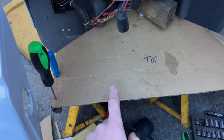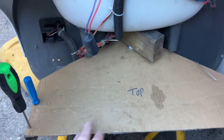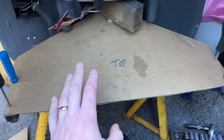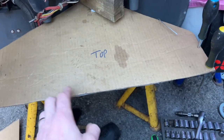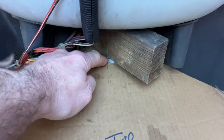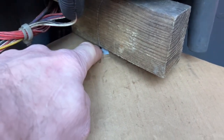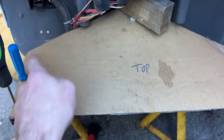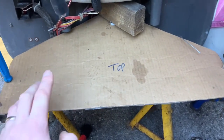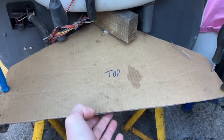Here we go — templates. What I did was remove the axle, lights, and electronics just to one side, giving all that free space. I then measured it up, got a bit of cardboard, drew it out a bit bigger, put it in place, and spent time getting the slit in the right place. The initial slit was way too big, so I put some paper on there and made it a little thinner, put it in place, and scored around it with a pen. Once happy with it, I made holes to lock it into position.